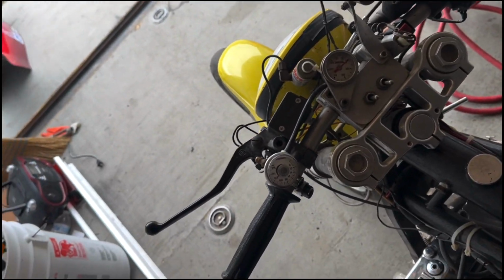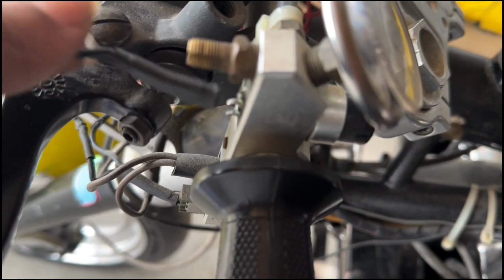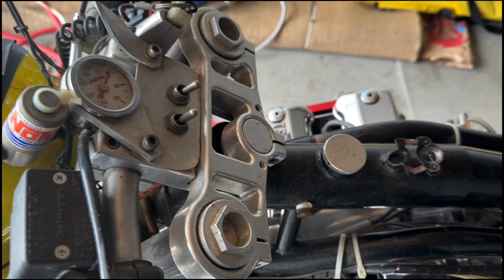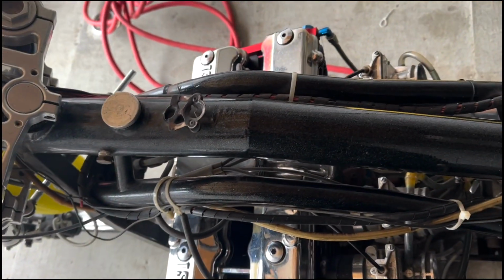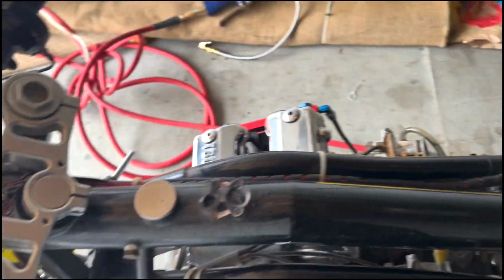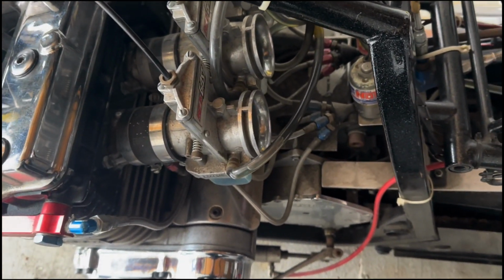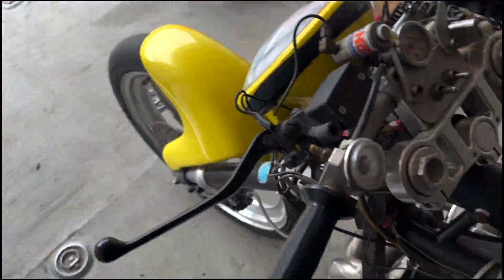I just found out something that'll be the common denominator. I know it's not the top one, but that one goes to here. This is the purge for the nitrous. So it's between the second one or the third one. Let's find out. Let's see if it's moving. Oh, that's it. That's the one right there. The middle one ain't on nothing. So, the bottom one isn't on anything.